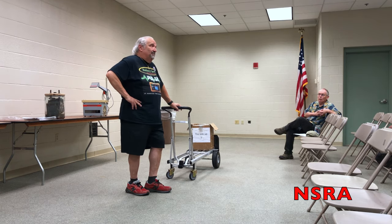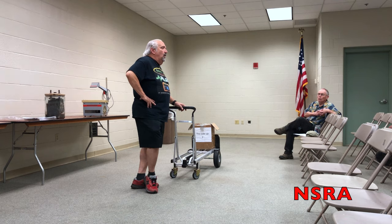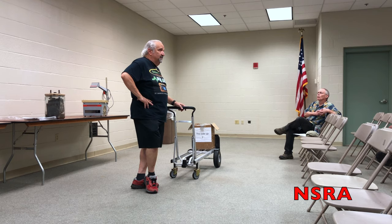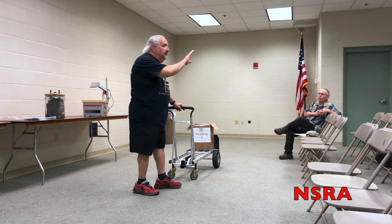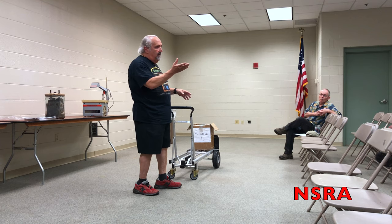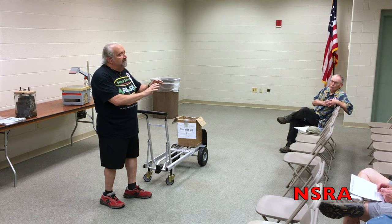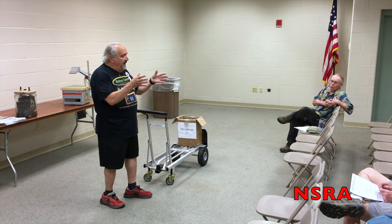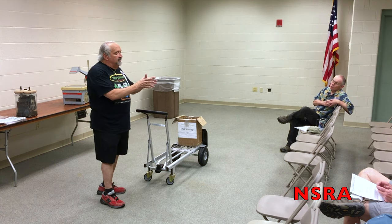Now, the other thing that kills batteries prematurely is cold. What happens with cold is when they're not being used, in storage. We have a place up in Michigan and a place in California, and the batteries in California inherently last longer because they hate to be brought down to 20 below. If your battery has been sitting there and it's not on something that's exercising it, the water is at the top. It's separated, sulfated, stratified. And water, as it freezes, expands. Even if it doesn't crack the outside shell, the lead plates are so thin that they flex as it thaws and as it freezes.